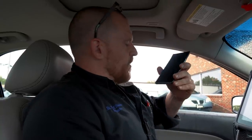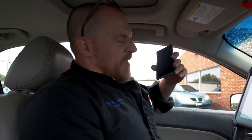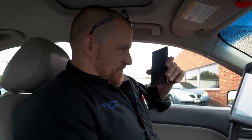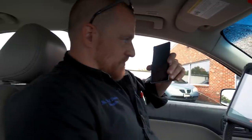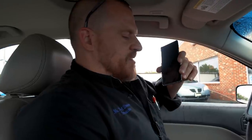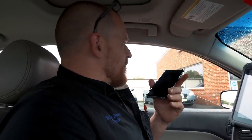But listen, I talked to Bill, and I told him where we are. I said I can wire in a resistor and make this work. The only problem is we're not going to have de-icing controls. It'll shut off on under-temperature with the pressure switch if there's something wrong on that side, or on pressures if it were to get too cold and ice. But if it gets too cold and ices, all that's going to do is block the airflow and freeze the evap. Can you think of any other damage we may cause by putting a resistor in this?